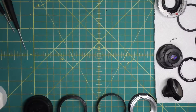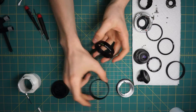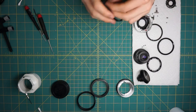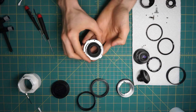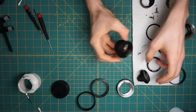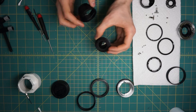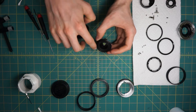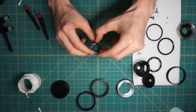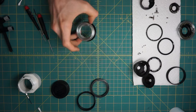So that has the disassembly of the lens complete, where I have separated the body sections — such as the aperture control ring, focusing ring, and some of the other ones like the rubber gripping ring and mounting plate — as much as reasonably possible, from everything else like the optics in here (which can be further disassembled using the other rings on the optical pieces) and the mechanical sections such as the diaphragm and the focusing ring.